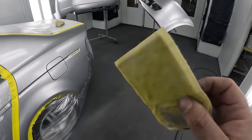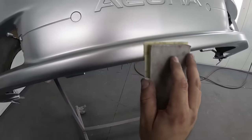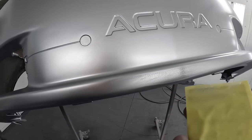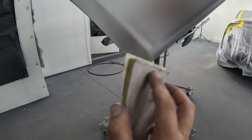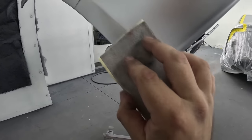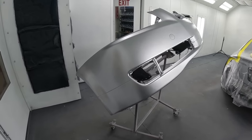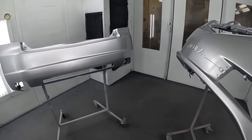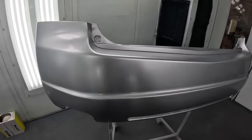A K800 hand pad works phenomenal for sanding base down. We're also spraying these bumpers in the same color, and I have a couple of areas I need to lightly go over. You'll see how it sands nice and smooth — we haven't eaten up the base or streaked it up. Since it has a cushion to it, it takes the curve very easily and doesn't apply the sandpaper too coarsely to the surface. If this whole bumper had dust nibs, you would gently go over it with an 800. We sealed both these bumpers and did the same exact thing we're doing on the quarter panel.